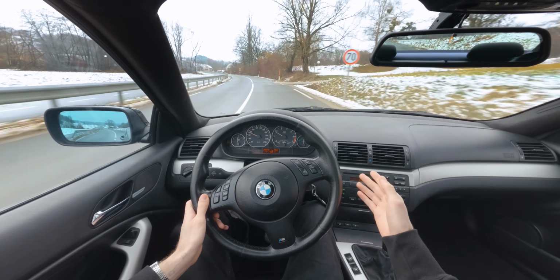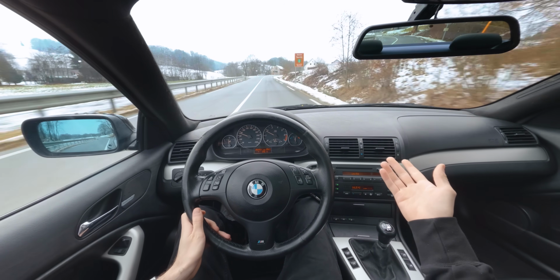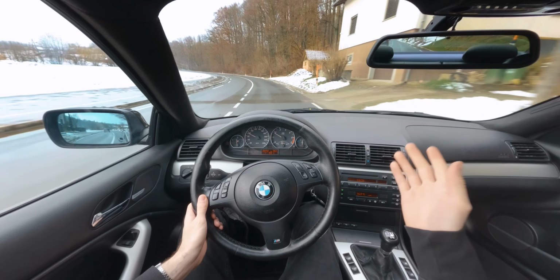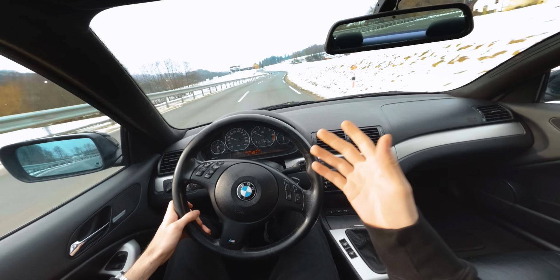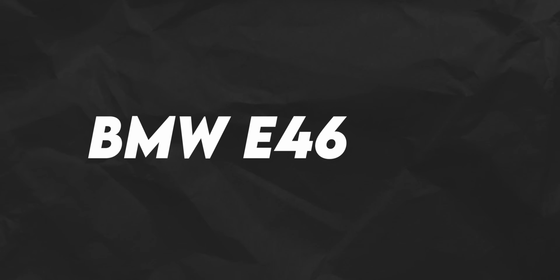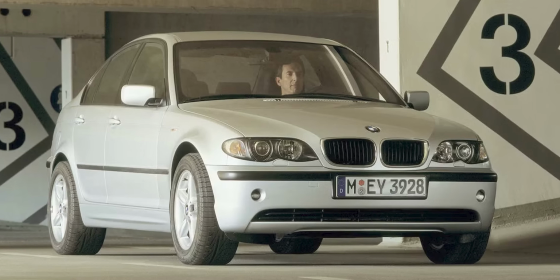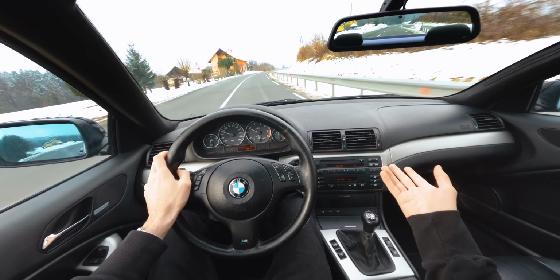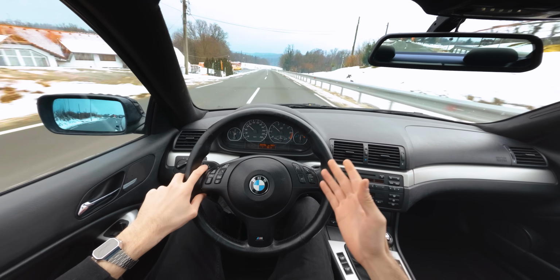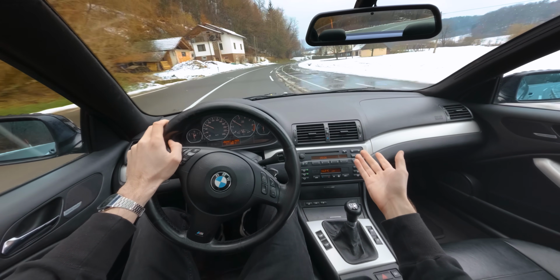But here's the thing, if your car isn't really near the top of the lineup in terms of power, you don't need to go crazy with wheel and tire sizes. You know, this is primarily a BMW YouTube channel, and I'm coming from the world of BMWs, so I'll make an example on a BMW E46 316i. I wouldn't go for the widest option on that car because it just doesn't have the horsepower to make the most out of, let's say, 255s in the rear, even though they are technically within the manufacturer's recommended sizes. You've got to match performance with the car's capabilities, not just looks.